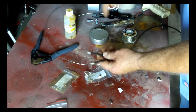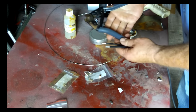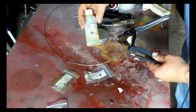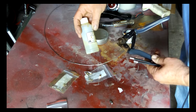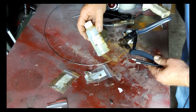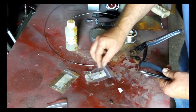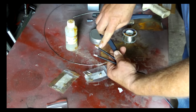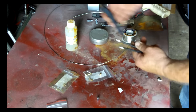Check out the link below. I'll show you where you get it. You need the proper tool to cut it with. You need the correct flux for it. I'm using a Superior number 75 flux. We're going to solder on one of these brass ends to it. You need some of the ferrules for the end of the cable, and I'm going to leave one end of the cable blank.